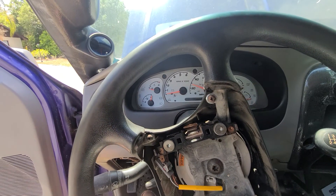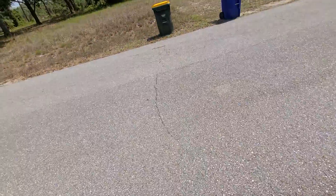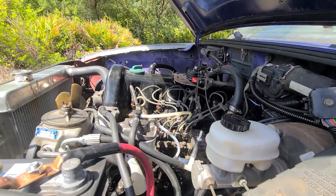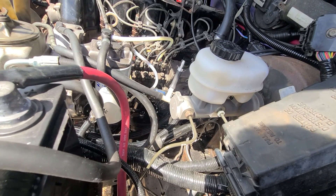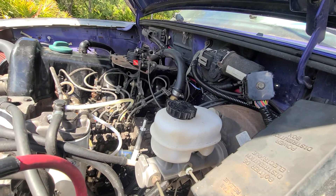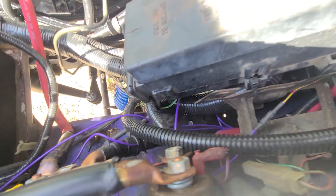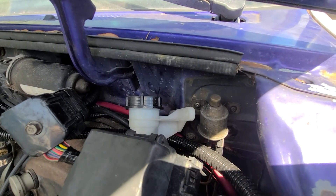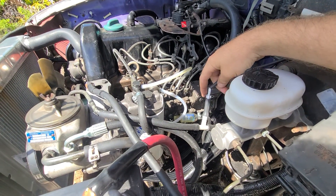Realistically, the wiring on this was just stripping out every single wire I knew I didn't need, like for the AC. If I could go back and do it again, I'd leave the two wires going to the master cylinder and jump those together with a jumper just to make the brake warning light go off. It's really just grounds and power and then the start wire, plus the overboost protection solenoid.